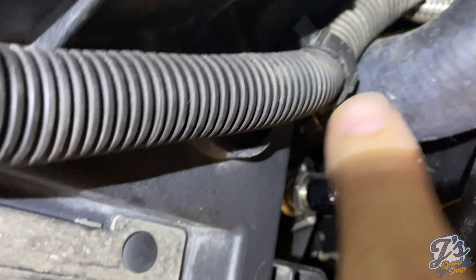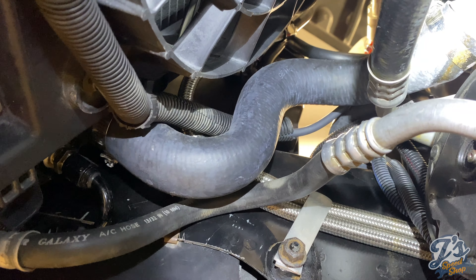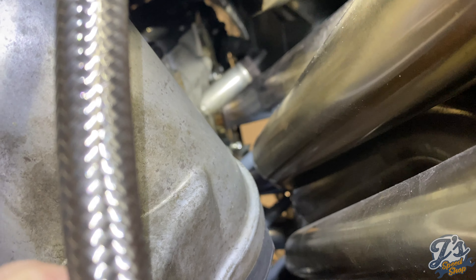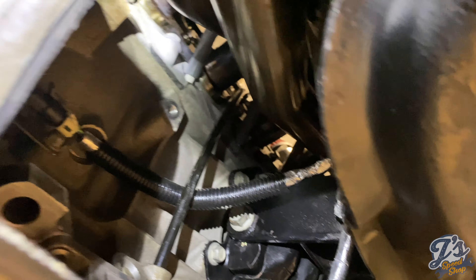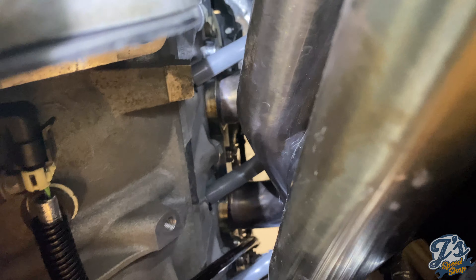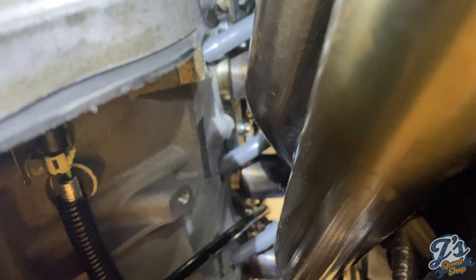So we've got the alternator wire reattached to the back of the alternator — it runs and clips back into the two clips on the fan shroud and goes up to the battery. Now from here we're going to work on that rear spark plug wire — you can kind of see it up there. It's going to be tight from either direction, and all the shielding is sharp. Also, that third spark plug wire doesn't look like it's on all the way, so I need to get that pushed on tighter too. Got the last spark plug wire on the spark plug from the bottom — but I can't physically get my arm high enough to reach the coil end without loosening the headers, so I'll get that from the top.